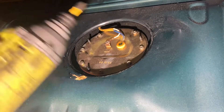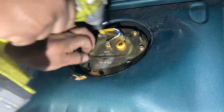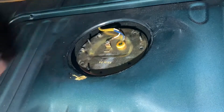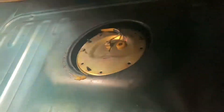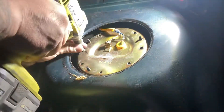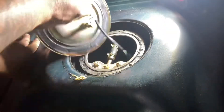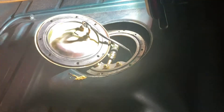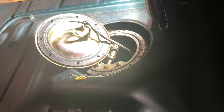Impact screwdriver or 8mm socket. This is also a really good way to see if the tank has any kind of rust, contaminants, or anything weird in the car. Peel it up and I'm gonna go ahead and take a look in the tank. Looks like we're about halfway or all the way full. It looks like we got a Walbro pump in here already, so at least he was running on a fuel pump, and what the guys told him when they sold him the car was true. So 10mm — you have three of them. Be careful not to drop them because you're gonna have to replace them if you lose them in there.